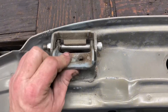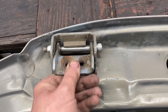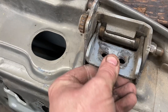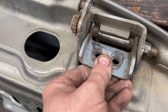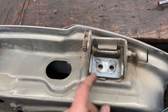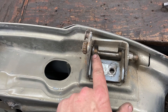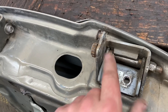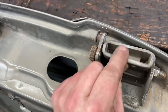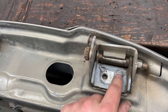When I put these in here, you can see that for the most part this one here is still good, still pretty tight. This one here there is some wear in there. I think what happened was when I did this repair these holes were oblong — they kind of wore right out — and we've got some damage here on this piece where it contacts. So we've got a couple problems going on with this one here.